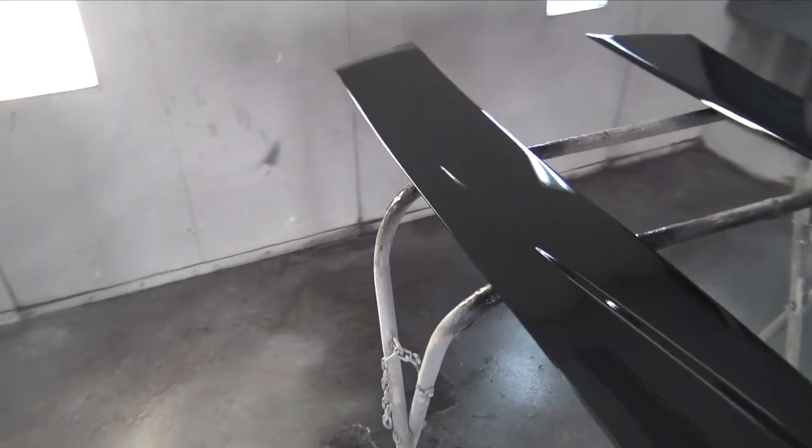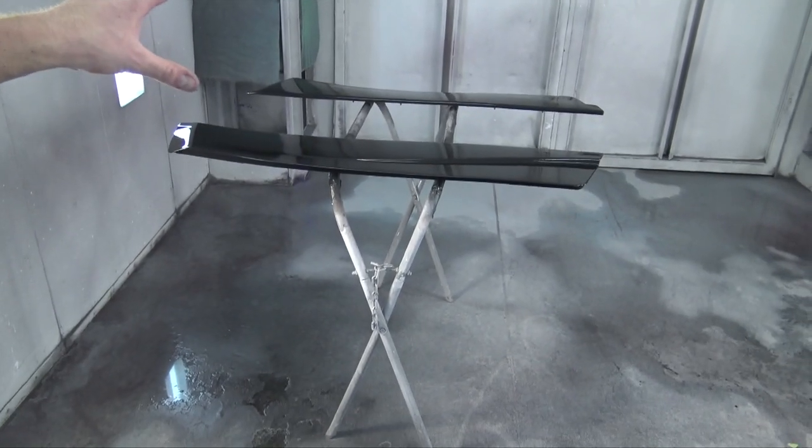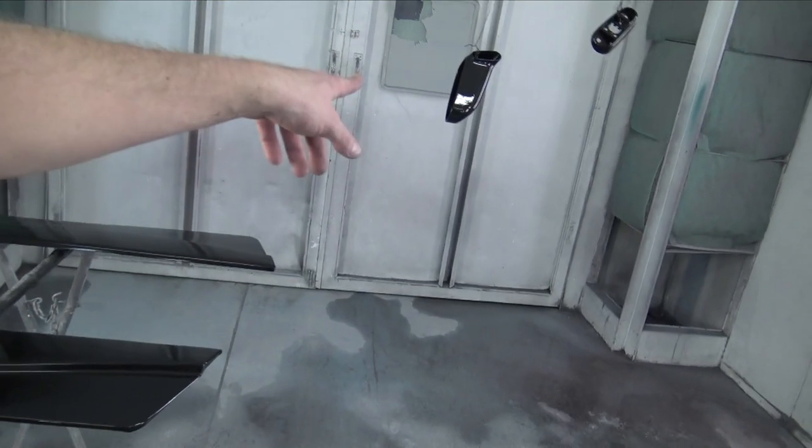The cladding came out really nice, but I just want to really let it sit because it has sat for quite a while and it was 320, but I want to 600 grit it and make sure. I can't actually remember what was going on with it, if everything was good or if I needed to prime it again. So the sealer will kind of give me a little better insight into what I need to do. If I just need a 600 grit and the basic clear it, just like the side skirts, that's what we'll do. Same thing with the mirrors.